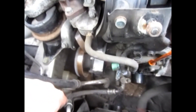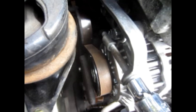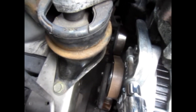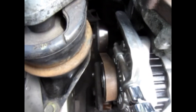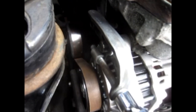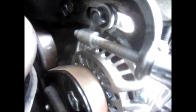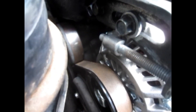Cleaning up around in here a little bit before I put in the new one. I've had to put the old belt back on for the time being. Some people suggest you have to remove the tray from the wheel arch, but I've managed to just slide my hand in, feel around, shine a torch down there and get it on. You might find it easier to remove the top bolt holding the alternator completely, because the slot in the adjusting bracket is only so far — take the bolt out and you can actually tuck the alternator right up against the engine block.